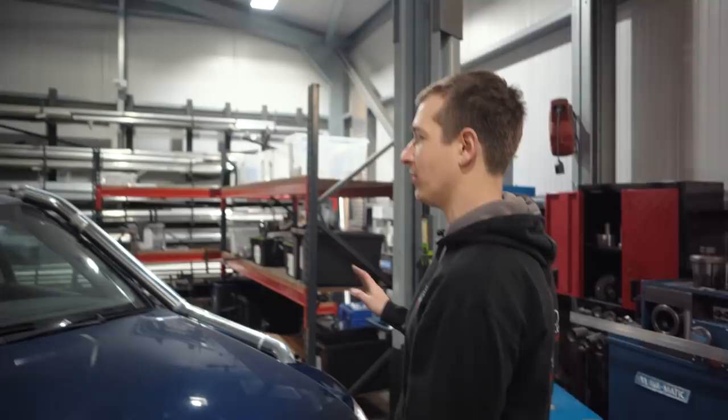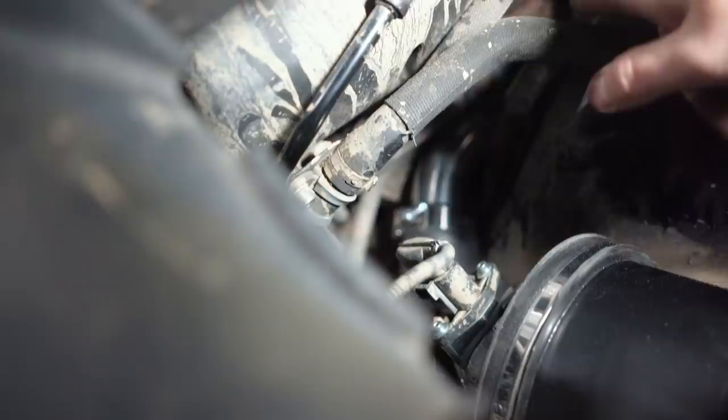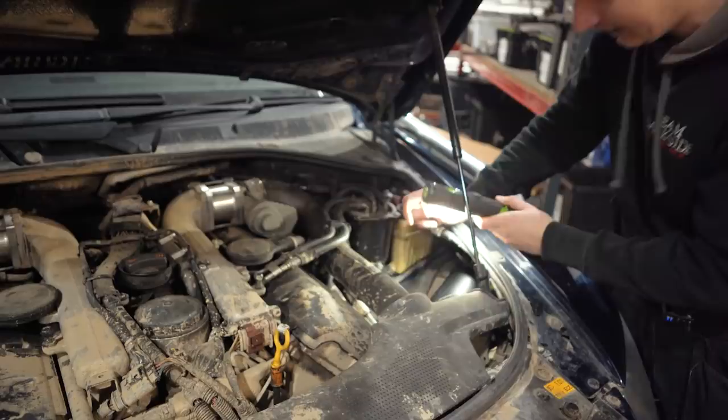So yeah, under the bonnet, you see the filters there, got the MAF sensor boss on there, hopefully that all works out. And then we did put a reducing silicone on there to the standard pipe, but that got in the way a little bit. It was a little bit too fat, it touched the exhaust manifold. So we've ended up putting the original pipe back on with a new Jubilee clip, and then we've reduced it down in the aluminium bend. So it's very, very tight. There's not really much else you can do with that.